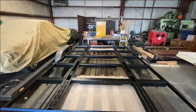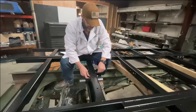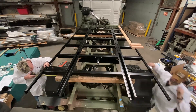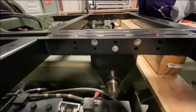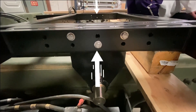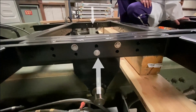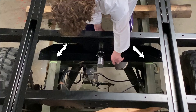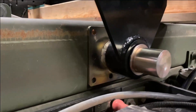In Part 1 we laid out the subframe in the exact position we wanted it, with the brackets attached, and we are ready to mark and drill the truck's frame rails to create attaching points. It is important to note that the side brackets — whether installing as a three-point or four-point system — must be mounted directly across from one another. Use a pencil or length of masking tape to mark the sides of the brackets to ensure their position is well noted.